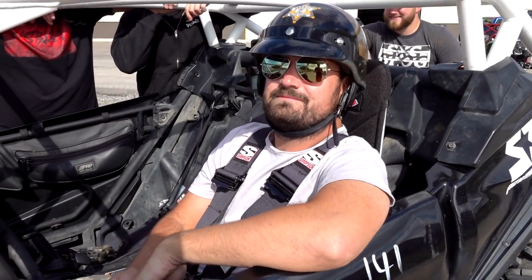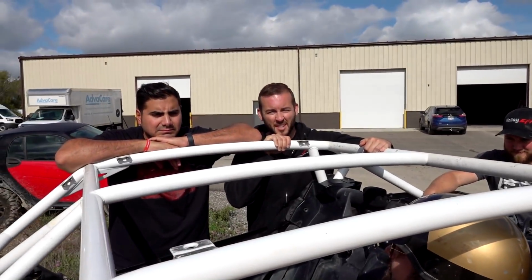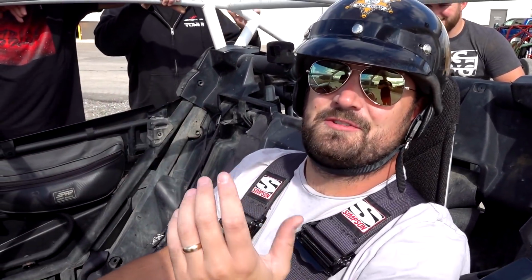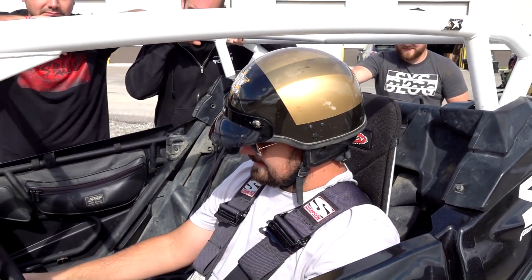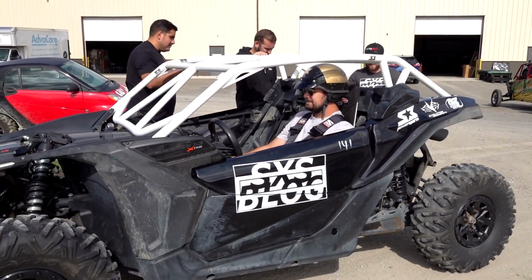It sounds like a classic misfire, ignition. 16 thousandths gap. Might not make sense to you, but it's what it likes. Guys, Rush is so small. All right, no big deal. Iridium's at 20 thousandths. You think that'd be fine? One would think that would work, but maybe. A lot of cylinder pressure in there, brother. A lot of cylinder pressure. We'll run her once more, dude. See what she wants.